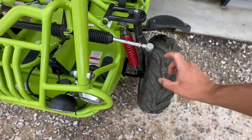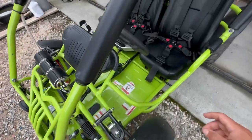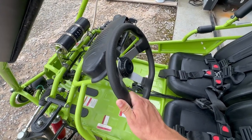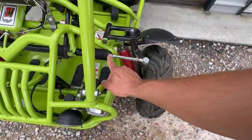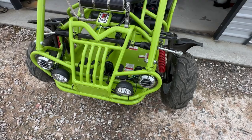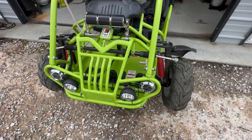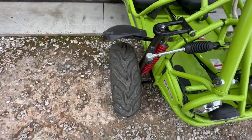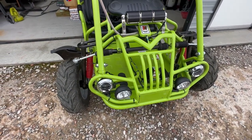The next thing to look out for is your wheel alignment adjustments. This adjusts your wheels in and out. When we first got it, I was driving and trying to go straight but the steering wheel was turned off-center. You can literally just loosen these nuts right here and adjust it. If you're not sure how to do alignment there are videos online — you just need a tape measure, or you can eyeball it. It does steer a lot tighter when you get the alignment right, and it rides a lot better as well.